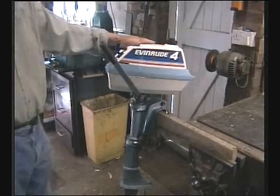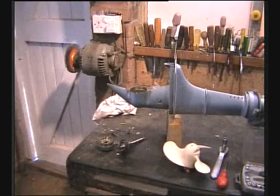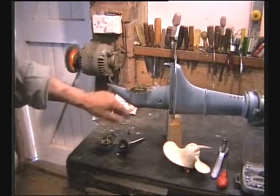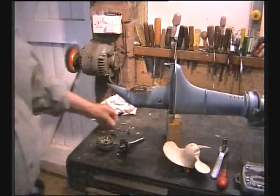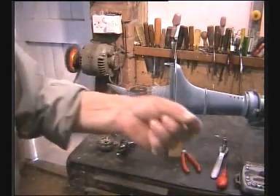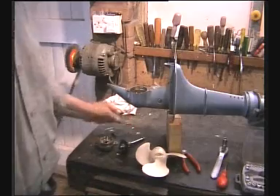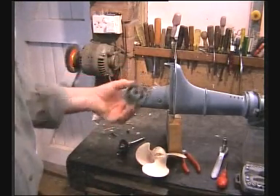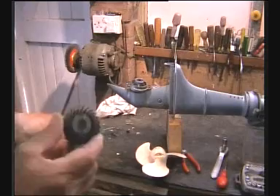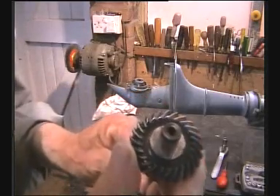I suspected we've got problems with the gearbox, so we'll have a look in the bottom first. A bit further on — I've put the outboard on the bench and turned it this way up, which saved me having to drain the oil from the gearbox. I took the split pin off the propeller, and underneath the propeller there's a little slot where there was a shear pin, so we put that somewhere safe. Then I undid the two bolts that hold down the bearing housing on the top, and withdrew the shaft and its main drive wheel.